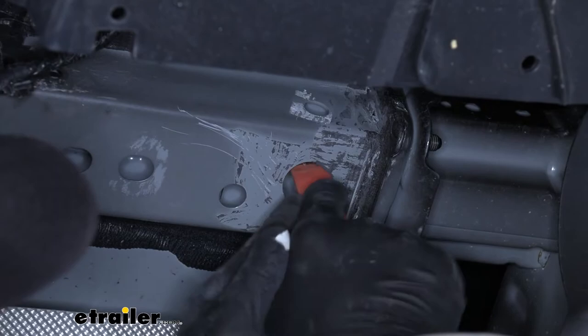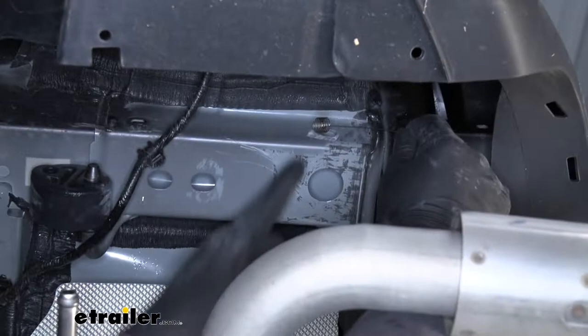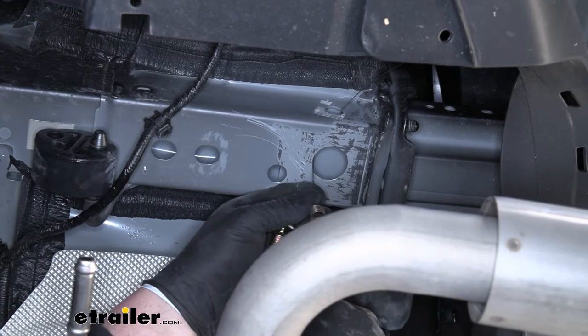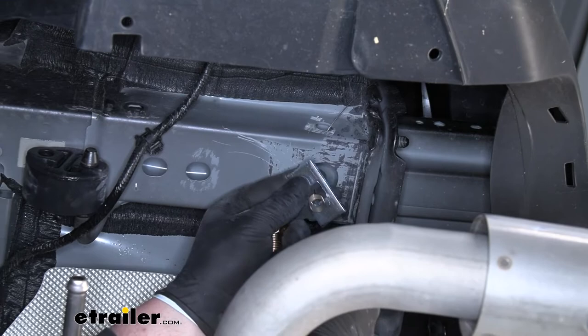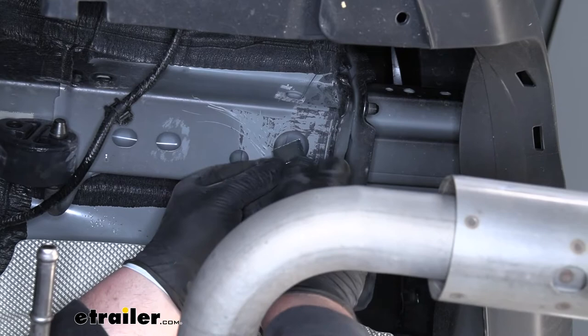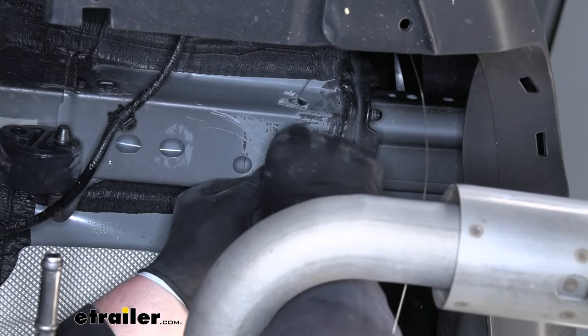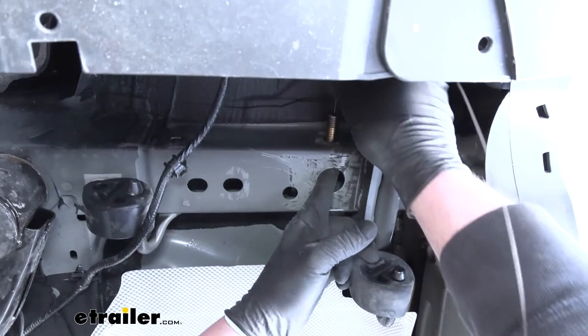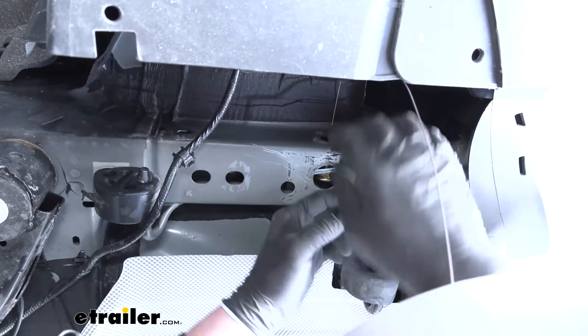To get our hardware into this attachment point, take the coiled end of your pull wire and feed it through the smaller hole in the side, then drop it out of the larger hole on the bottom of the frame rail. Take a spacer block, put that over the pull wire, and then a carriage bolt — thread that carriage bolt onto the pull wire and feed the hardware up into the frame rail. Pull on the bolt to get it to come out. Once we've verified the hardware comes through properly, just barely push the bolt back inside the frame so it won't interfere when we go to put our hitch up.